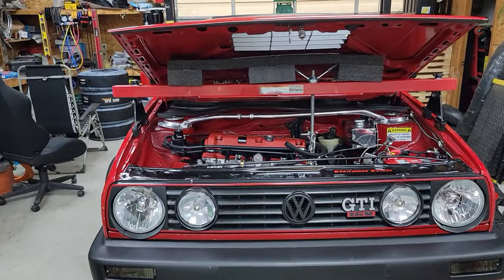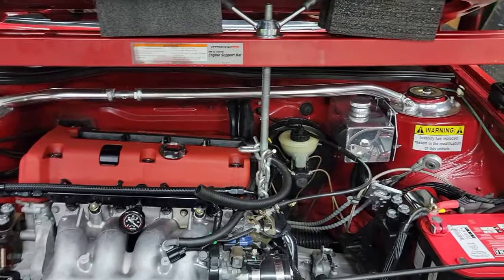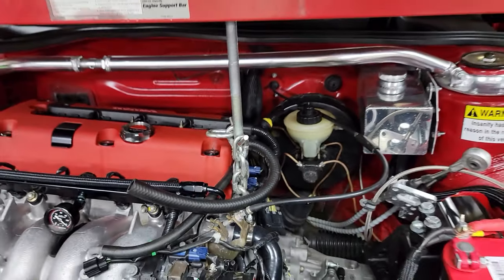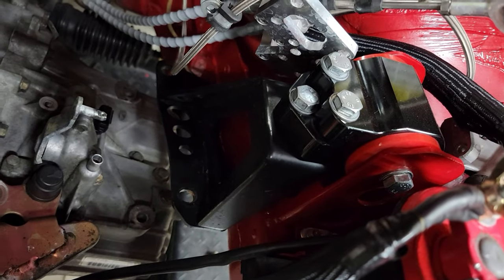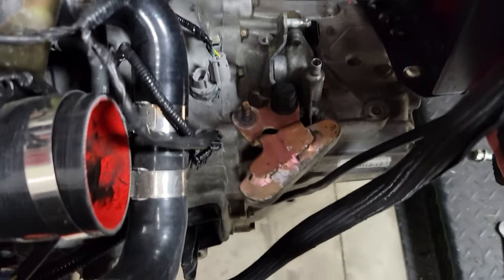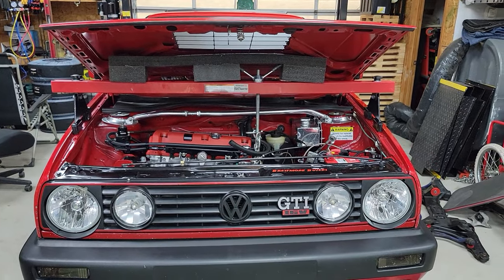Okay, so here's how we're doing this. We got one of these devices from Harbor Freight. It's actually a nice device, like an engine support. Put a bolt through down here, supported off a chain. I was able to unhook the motor mount already and lower this side down. We're hoping to pull this out and down out from under since we have a lift. So I was able to get the bolts out up top. So we're gonna lift it up and go from there.